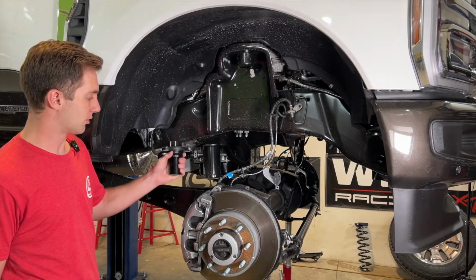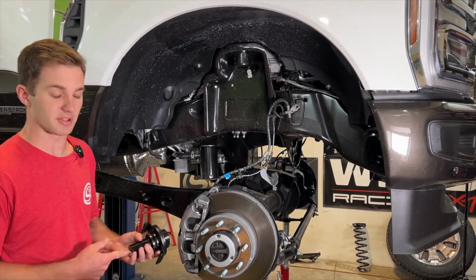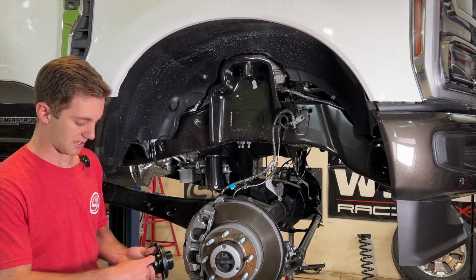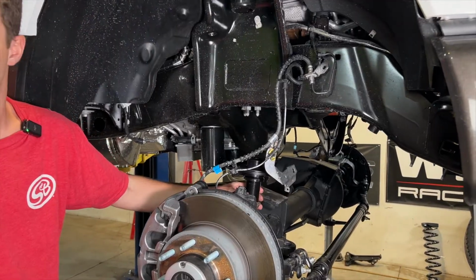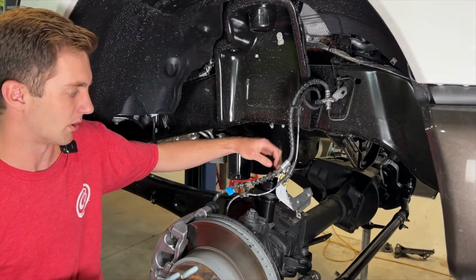So we've got our adjustable leveler here. On this truck, we're going to go 2.5 inches from the bottom of the stud as a good starting point, and then we'll measure it and adjust left to right, front to back once we're in. So I'm just going to tape measure 2.5 off here. The post is going to install right on the axle. You'll see it once it's installed, and then the bolt's going to drop in from the top. There's a washer as well.